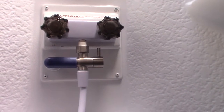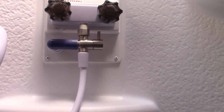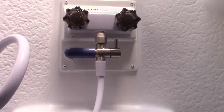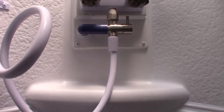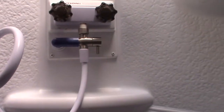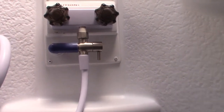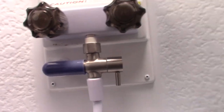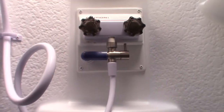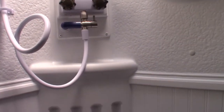Everything in the bathroom itself is the same as at home. You've got a shower and a sink. The shower has a feature called a water miser, right here. What this does is it recirculates water. The idea is if you're waiting for the water to heat up, you don't want to just waste water by sending it down the drain to the gray tank. You can put it into this mode and it will recirculate — send it around in a loop until this changes color to a richer blue, which means the water's hot. Then you flip it to the normal position and use the shower like normal. It just keeps you from wasting water and wasting storage space in your gray tank.